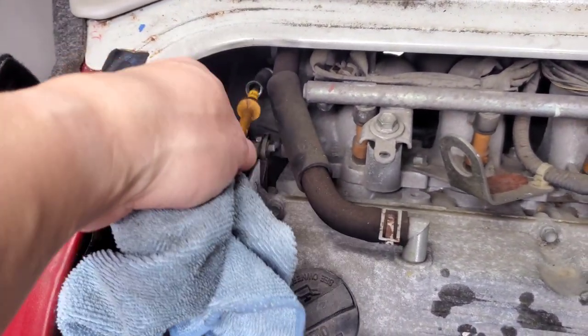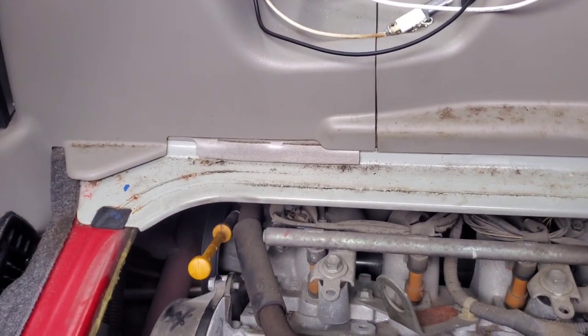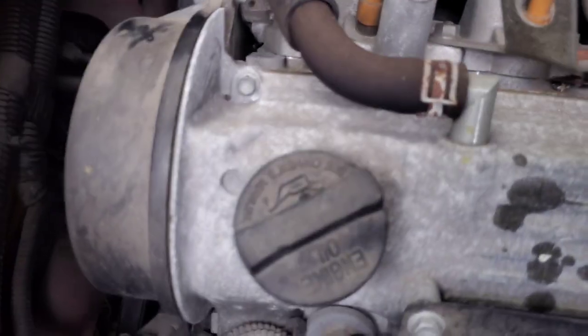Right now it's showing half because the van is a little bit on a slope — we're not quite leveled. But I feel confident I'm showing three and a half on a tilted van and the manufacturer said I need 3.6 quarts. I'm confident enough that I can start this car. For the double check: I check the bolt — it's tightened. I check the oil filter — tightened. I put in 3.6 quarts of oil. I put the cover back snug and put the dipstick back. Now I can start the engine. It's raining right now, I'm getting wet, but it's all good.